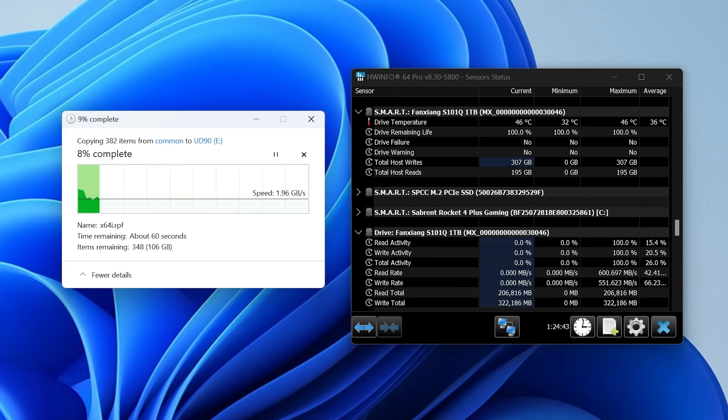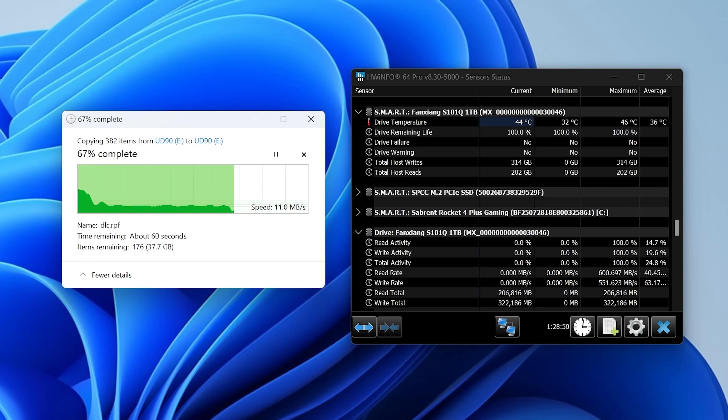As for file transfers from a faster drive that I know can do over 3GB/s, this UD90 peaks at around 3GB/s but isn't the most stable there. It bounces between a touch over 3 and down to the low 2GB/s mark, which isn't bad, although it isn't the absolute best I've seen. My usual file duplication stress test shows some interesting performance. Initially running at a respectable 1.7GB/s, but after 50GB of duplicating — so 150GB total — it drops to around 1.1GB/s. After a further 70GB or so on top of that, the performance just drops off a cliff, sitting at 250MB/s. That's hard drive speeds. That's not exactly appealing.